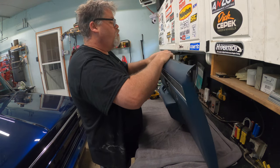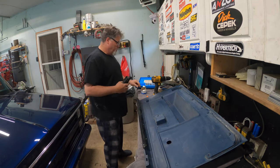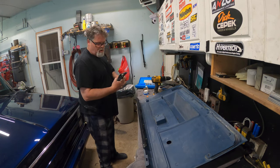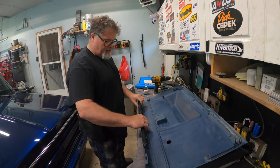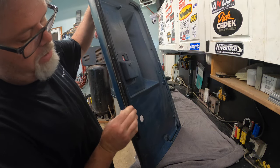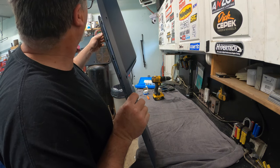Oh yeah, freaking right! We did it — it's a Catalina wine mixer! I think I only need one more right there. I've got a little bow on my door panel, gonna get that little bow out of there. Oh yeah, that looks good — I think we got her. So I put rivets along that edge there. They won't hit the glass because they're behind the trim piece, and just on the inside you want to make sure the rivets are flatter than the clip or it won't clip back on.